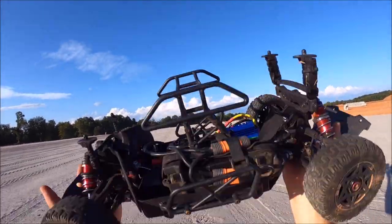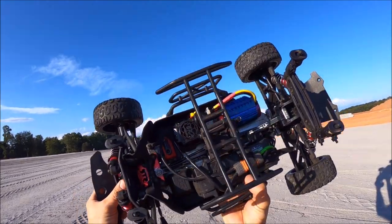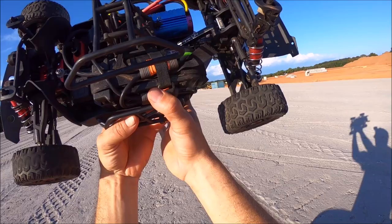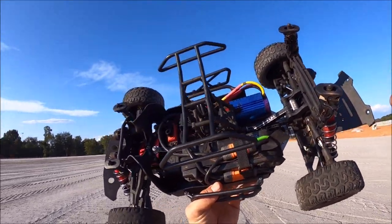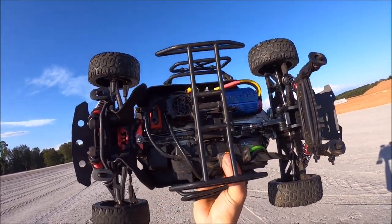And real quick, it's got the M2C lightened speed chassis on it, 3mm speed chassis, which is perfect for this platform. I'm running Senton towers on here and shocks with a 2000 CST in the shocks. I did do some suspension adjusting with the droop and stuff, just to get it where it handles really nice in the street and, you know, off-road at the same time.